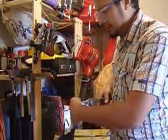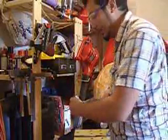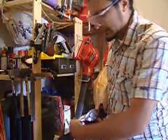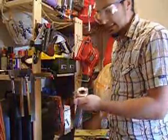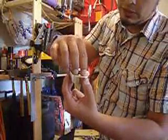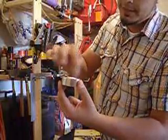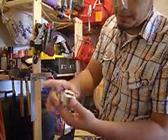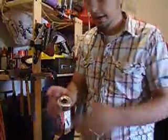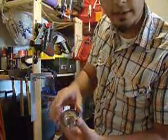This particular steel is harder than some of the other spice canisters. Aluminum is a lot more soft, so it's a little bit easier to work with than this sort of stainless steel stuff. But anyway, you can see essentially what I'll do is I'll just take the snips around. It doesn't take very long. I'll take it back to maybe a quarter inch from the edge and I'll sort of try and smooth out the edges with one of these deburring bits. And then later on I'll put the mesh from the inside and I'll show you that.